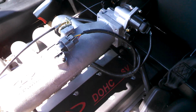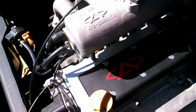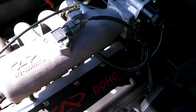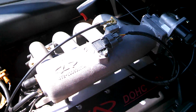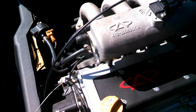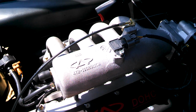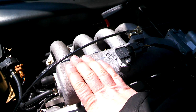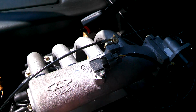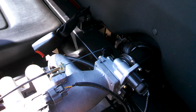This is Chery, C-H-E-R-Y. It's a dual overhead cam, 16 valve, 1100 cc, inline 4. A very big car manufacturer, truck, van, everything. They make entire vehicles. This is one of the more popular motors that they use. UTVs, go-karts, dune buggy type vehicles. And most of those are sticks, where this has been made into a CVT automatic.